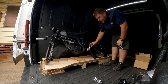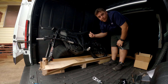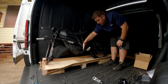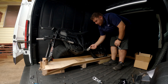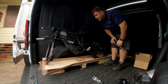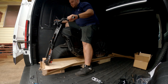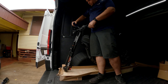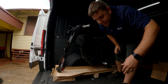If you're ever confused on what side the peg goes on, with the bike facing forward you always want the peg to come upwards towards the back, so that if you do come in contact with something it's always going to want to go back. You don't want it pushing forward. Make sure you route your wires how you want them. I'm going to put the other peg on real quick since I've got the bike right here.